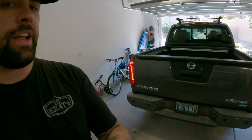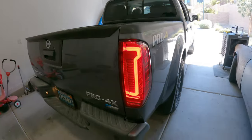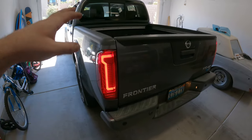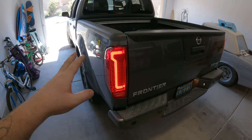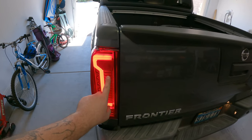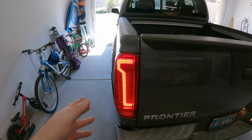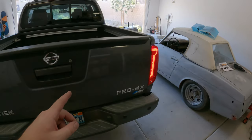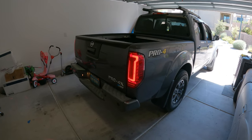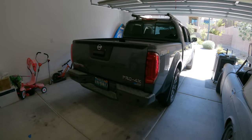They're installed, and I have to say it looks so much better than the factory tail lights - so much more modern. The illuminated strip just looks really cool. Wiring wasn't too bad. I actually wired it wrong originally for just the main light and the brake light - this portion was on but not that one, and when you hit the brake pedal that would illuminate, which is backwards. I will make sure to have the correct wiring diagram and pictures uploaded so you guys can get the wiring right the first time. Overall, I'm super happy with how it came out.